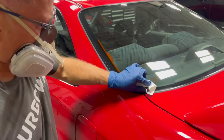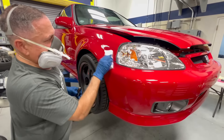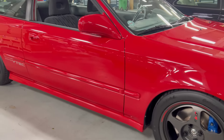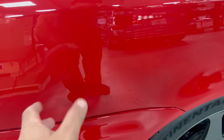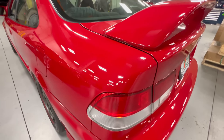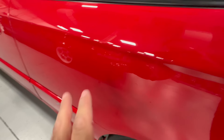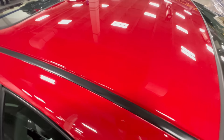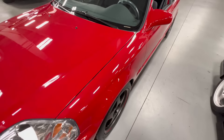Once we got it all applied, I came around and wiped it off after two or three minutes after it hazed up. This car is polished completely, swirl-free, and protected. This is no ordinary Honda Civic — it's an EM1 chassis with more value than the actual labor and material of the paint job, but combining both together gives you a true masterpiece and time capsule. The gloss retention is just stunning. With two coats of clear, we still have all the UV protection since we only sanded it down with 2000 grit. If you intend to sand with a more coarse grit, make sure you put on three coats. This is Brian from Paint Society — don't overthink it, it's just paint.